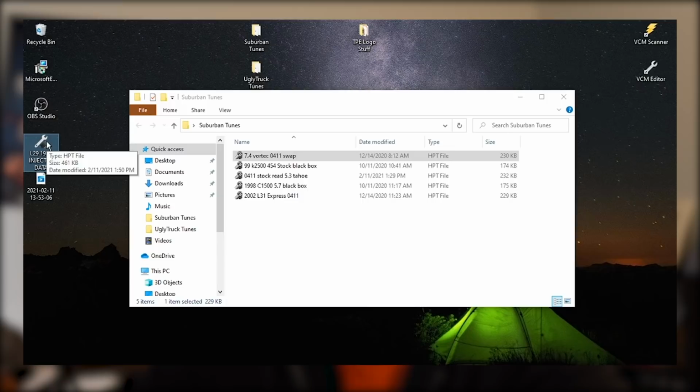But luckily, I did find another tune file right here that has some 22 pound per hour injector data in it. And the reason I keep going back and forth between 19 and 22 pound per hour is because some injectors are rated at 43 PSI and some are rated at 58 PSI. And that's just the difference. It's the same injector, it's just at a different pressure. It has a different flow rating. So anyway,